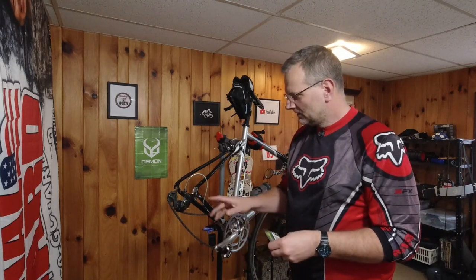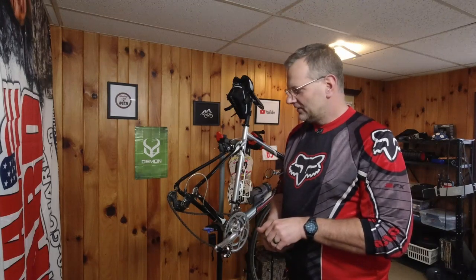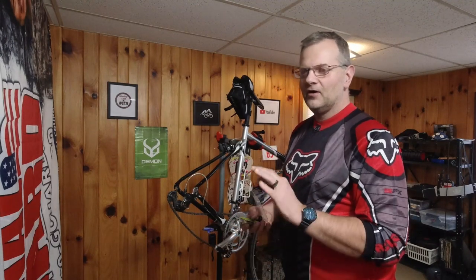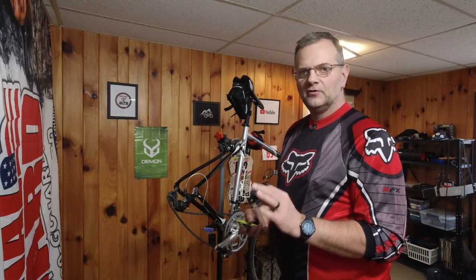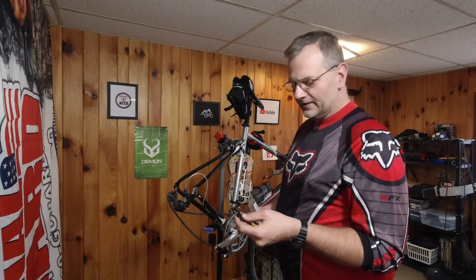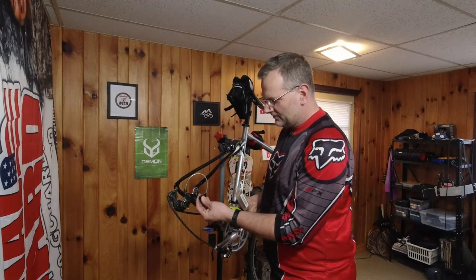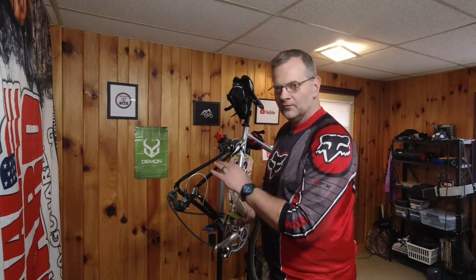With this only being good for 28, you're asking how is that going to work, because a short cage or medium cage derailleur is just not going to work with something bigger — you need a different derailleur. Well, enter the spacers. You can get these from Wolf Tooth — this is a Risk brand I got off Amazon. You can get them anywhere; Amazon, Wish, AliExpress, everybody sells these. The Wolf Tooth one runs about $20. I went with Risk, so maybe I'm taking some risk, but it had good reviews and was relatively inexpensive. I'll leave a link in the description. Instead of your derailleur mounting to your derailleur hanger, this mounts to the hanger and then your derailleur mounts to this.